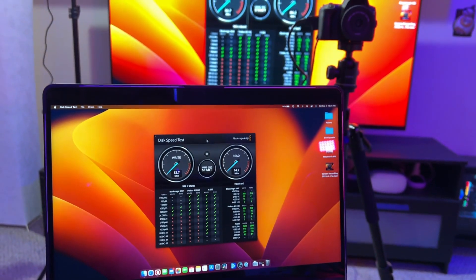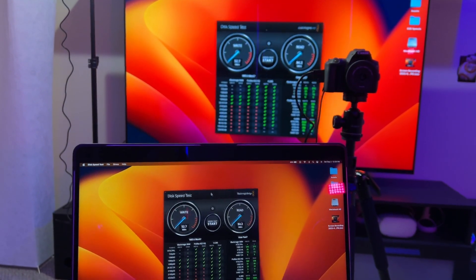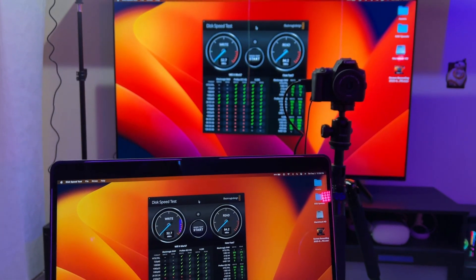For 4K display testing, both extension and mirroring work as promised — extending to an external monitor at 4K 30. Reducing to lower resolutions did not allow 60Hz refresh rate, so you won't get that 60Hz. Otherwise, everything else is on par, including the transfer rates, which are genuinely impressive.